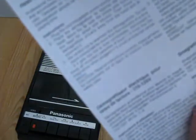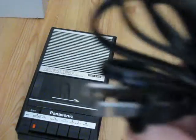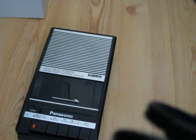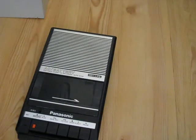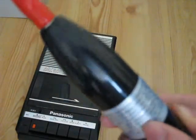The back just says instructions in multiple languages. Taking out the packaging — here's the unit itself. So you just plug it into the wall and turn it on. Here's the part that you put against your tape heads. It says to plug it into the power source, place the magnetic tip against the recording head, and move the tip over the entire pulse surface of the head for about one second, then move the demagnetizer slowly away from the head.